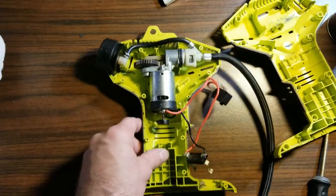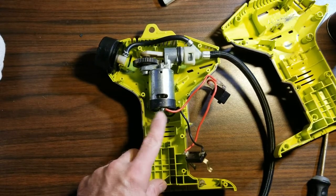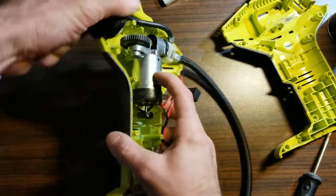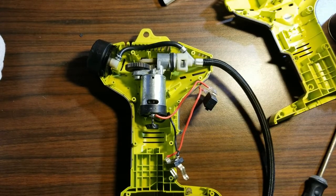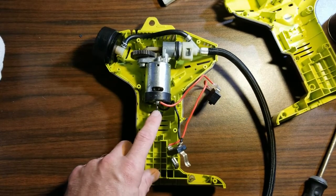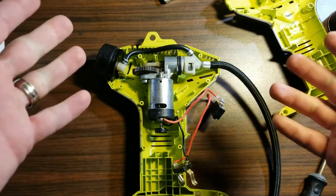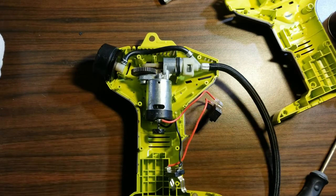If you hear a rattling sound inside of your RYOBI air compressor, it is more than likely due to this — the fan. It's supposed to have blades sticking out to cool the unit when you're using it. You're going to hear a lot of rattling because the fan blades get obliterated inside. Just shake those out gently and clear everything out. You might even find a little stud from the frame broken inside. After fixing these issues, I found the fan really isn't needed if you don't overwork it — do one tire, give it a break for a couple minutes, then fill another tire.